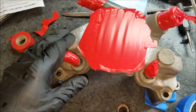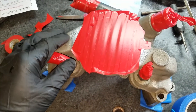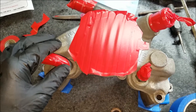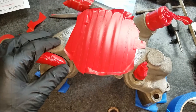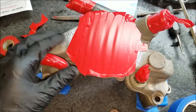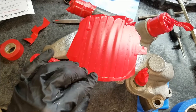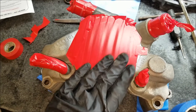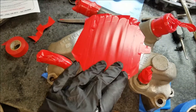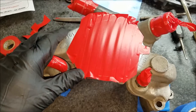While I have it out and I'm doing other work on the car, I'll go ahead and clean up the whole outside in my sandblast cabinet. It's probably unnecessary — you could use mag wheel etching spray, apply it, power wash it off, and it really takes off any grime and eats it out of the aluminum. That's probably the easiest way, but it's very cold today so I'm going with the sandblasting cabinet. I sealed everything up to keep debris from getting inside the pump.